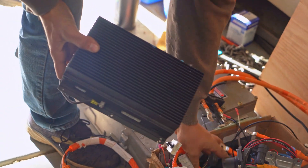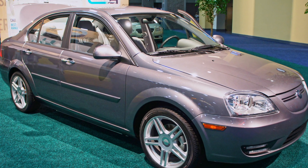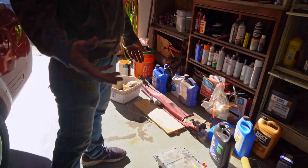This drivetrain came out of a car called the Coda. They made maybe 100 to 150 of them back around 2012. They put out the first 100 with an excellent drivetrain and pretty good batteries, but kind of a goofy chassis — like a 90s sedan with a great electric drivetrain. It got around 150-mile range, high top speed, great acceleration, but the chassis was pretty low-end: door handles would fall off, windows wouldn't roll up and down. So now there are a bunch of Codas that no longer function because various things fall apart and there's no manufacturer support, but we can hack into the drivetrain components and repurpose them. This component here is a DC-to-DC converter — because there's no alternator, you take high voltage in and put 12 volts out, just like an alternator, but in a small box with no spinning parts.